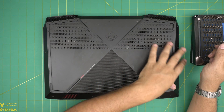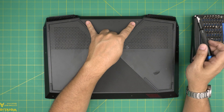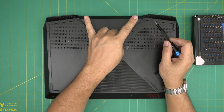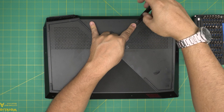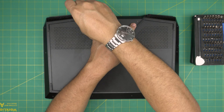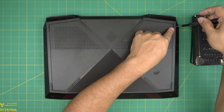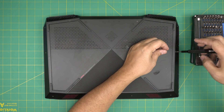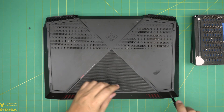On the bottom of the laptop you're going to see a bunch of screws. There are two screws on the back far mid, and these screws have a little C-lock on the other end so they won't come out entirely — just rotate and leave them loose. The rest of the screws on the sides are all the same size and height, so remove them and keep them in one pile. Don't worry about mismatching them.